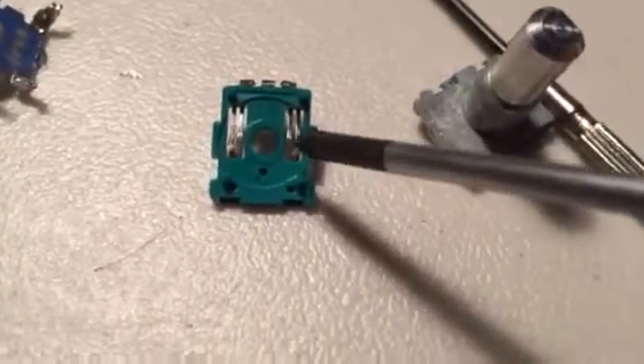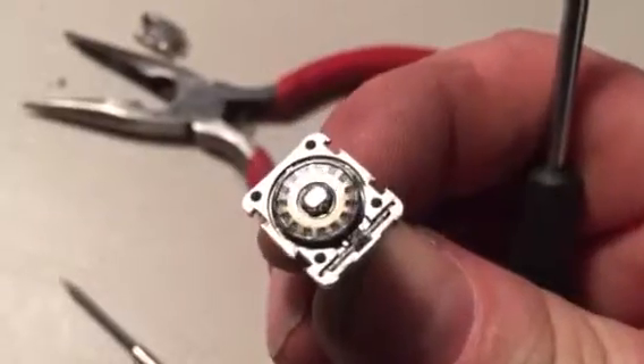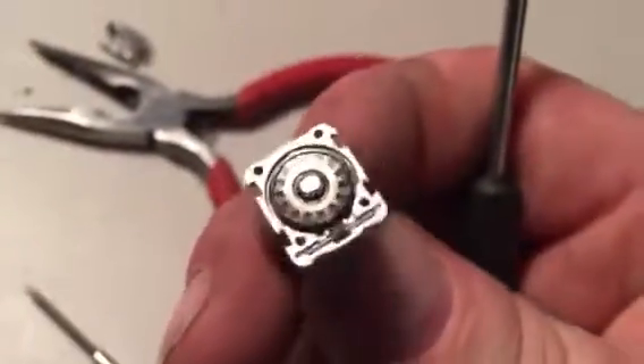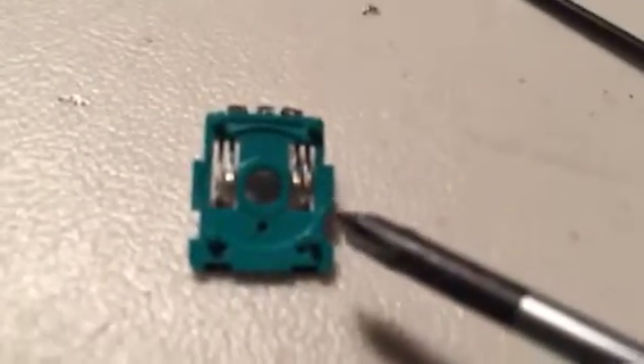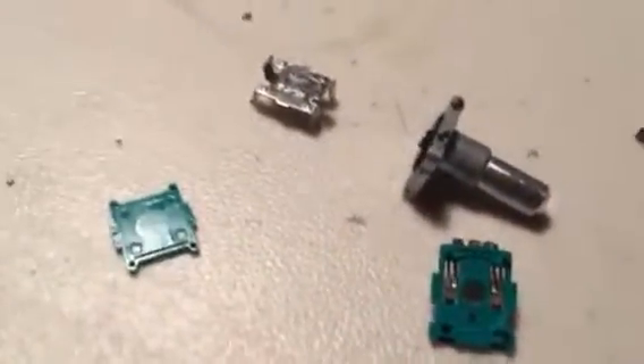It's a little bit tight, I've got a little bit more fettling to do, but that's about the only major issue. That's the bottom plate with the three pins on it, and there are some little contacts there - that's the very bottom plate, and that's the retaining clip that keeps it all together. On the back of that there is the encoding plate, if you like. People have attempted to fix these, but these are little spring contacts - it might just be a matter of tensioning those up and cleaning, and it might go back together and work again.